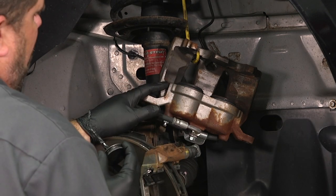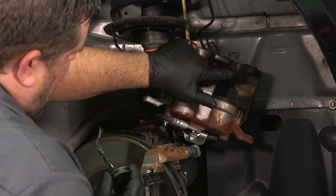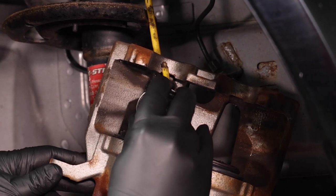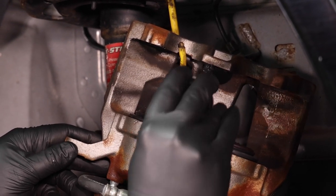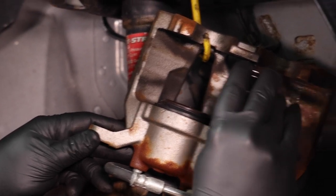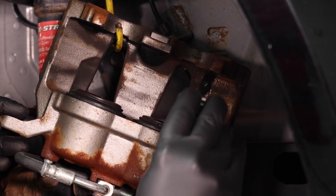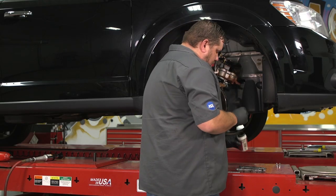I'm going to get some on my brush and go right up to the caliper. Where is this caliper going to contact my brake pads? It's going to be this point here, this one here, and that one there — all those nice flat machined surfaces, plus my two pistons. Starting up here at the top with my brush — it doesn't take a whole lot. I'll get that one and this one in the middle really well. It's just a coating, not globs of it.